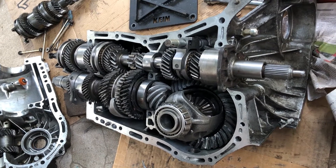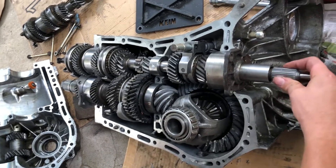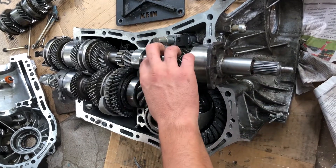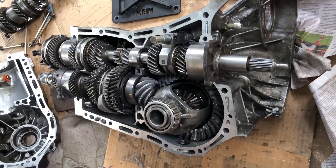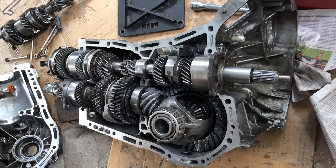It'll be interesting to find out which car it comes from. It's an interesting device but it probably weakens the system — now you don't have a solid shaft and there's more stuff that can break. The five-speed manual transmissions on Subarus are not the strongest transmissions, especially if you're going to build the engine for more power.